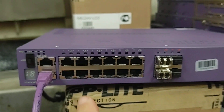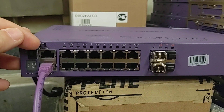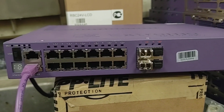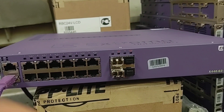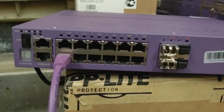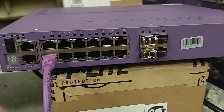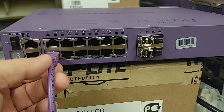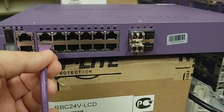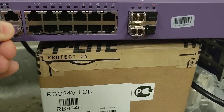The top port is if you have a separate management Ethernet network — you can use it just for management of the device. We don't do that with our switches, although we do it with our firewalls. The rest are all Ethernet ports. Don't plug your serial cable into an Ethernet port — not going to work. It shouldn't damage anything, but it depends on the switch, the manufacturer, and your laptop. Most switches will just say they don't know what that is and not do anything with it, because the pinouts are completely different. So plug it into your console port.